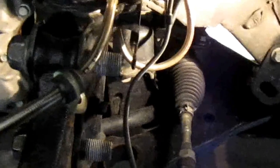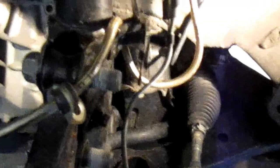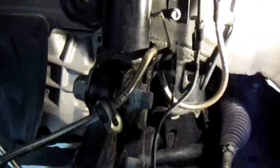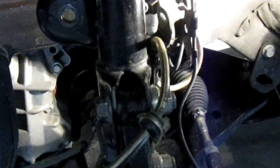These two bolts are in. Now we just have to torque them to 240 foot-pounds, which is pretty much almost impossible. I have a 150 foot-pound torque range, so I'll torque it to that, and then after that just use a breaker bar and push my weight on it. Okay, so these two bolts are torqued. Now we're just going to put back the brackets for the brake line and ABS sensor.